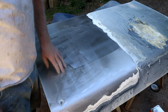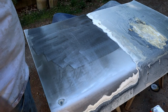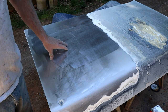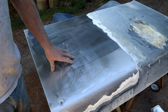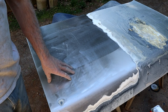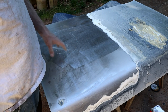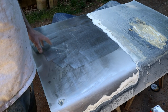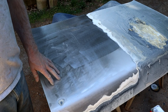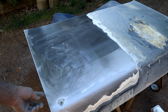Just like in the furniture game, you want to get that finish off with as little disturbance to the base material as possible. With an extremely aggressive sander — say 36-grit — you run the danger of cutting into the metal itself, distorting it, and causing problems. With this machine I find it's a really good medium — it's aggressive enough, and that stripping wheel, which looks like a kind of popcorn or Rice Krispie bar texture, doesn't cut into the metal, or only very minimally.